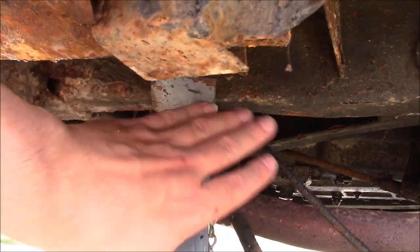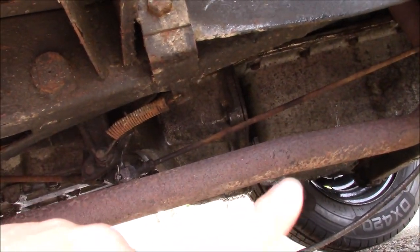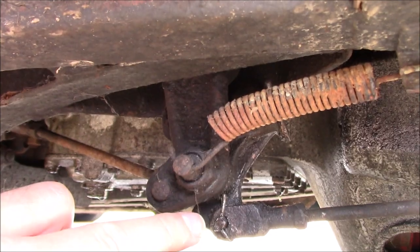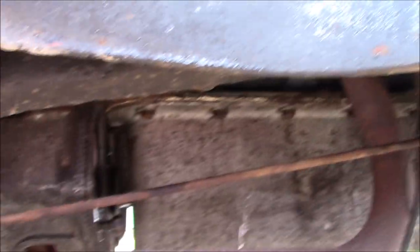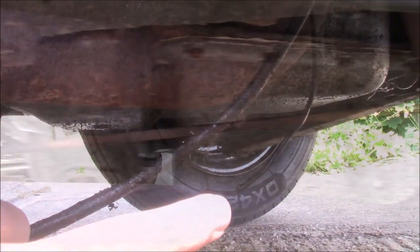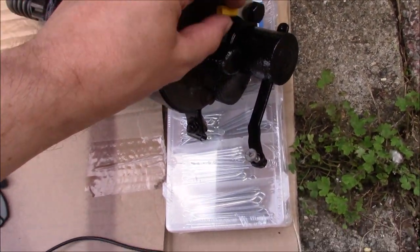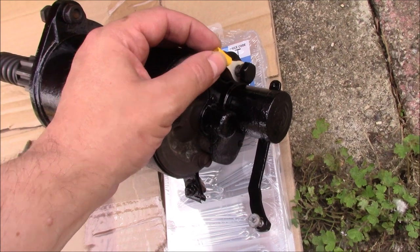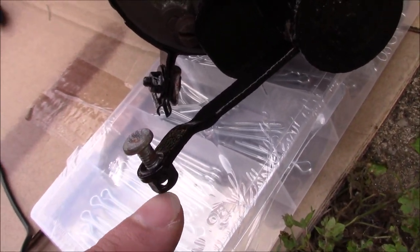The car is supported on my chassis here, nice and secure. I am going to chock that other wheel just in case - shouldn't need to, but it's nice to be safe. The first job will be removing that cotter pin. I bought some new ones, and that will allow us to get this brake rod out of the way so the starter motor can go back in its hole where it lives. This black wire here needs a new eyelet crimping on. I've got some new ones today. This is going to be the new eyelet for that black wire, a nice brand new connector. I could have reused the old one, it's just easier to use a new one. And I've got a new screw in here, and that's the cable clamp for the starter pull.